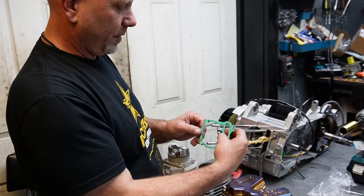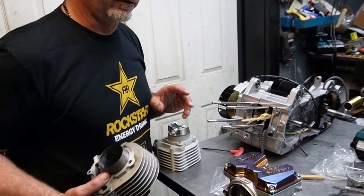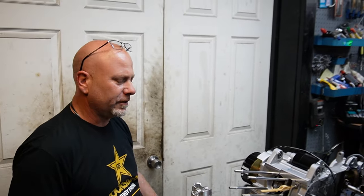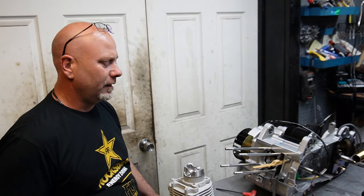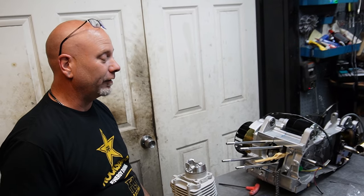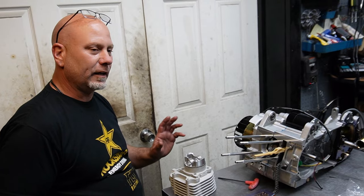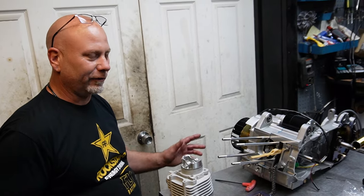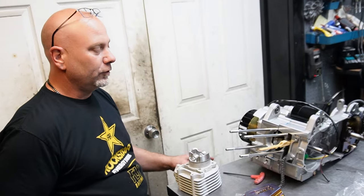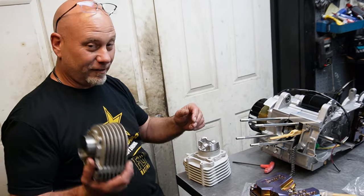As far as the stud spacing, what people don't understand is they think, oh, well, bore it out. I see a lot of people on Facebook give misinformation. It's just because they don't know any better. They hear there's a 232 motor out there, and just because it's capable, they think you can take any GY6 and bore it out to 232, or bore it out to 67 millimeter and whatnot. It's not the case. You could probably fit the stroker crank in an A case. Again, you'd have to space the cylinder up.